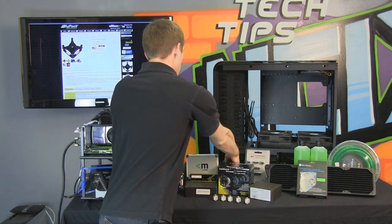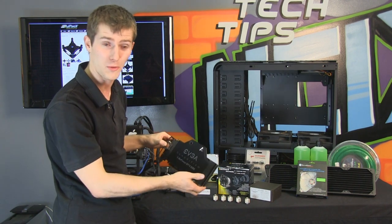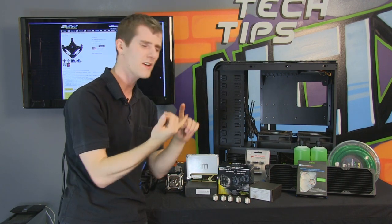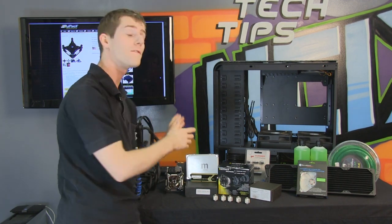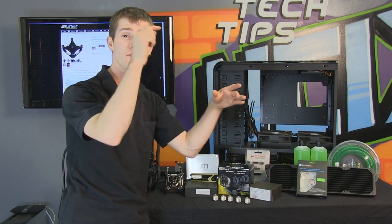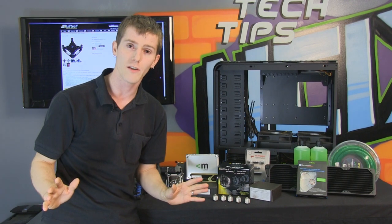In terms of video cards, there aren't many options for ultimate water cooled video cards. There's the GTX 590 or the EVGA Classified GTX 590 with a water block — so we went with the one with the water block. You can cool video cards using individual GPU blocks and little sinks for the RAM, but it looks tacky and is less reliable. I've personally had a RAM sink or VRM sink fall off during operation — in one case it fell off the top SLI card onto the back of the bottom card and shorted out the system. I prefer full cover blocks from then on.